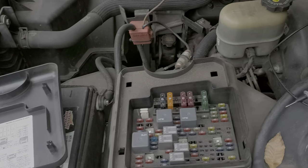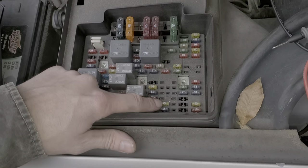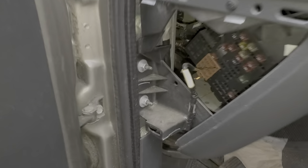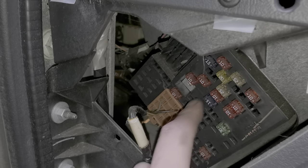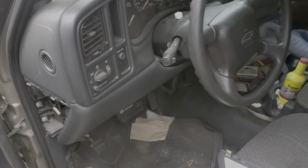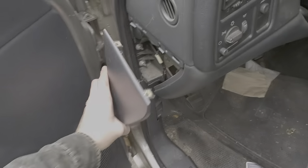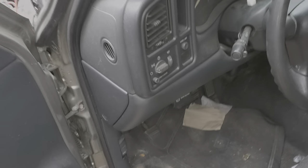So that's about it. You're going to want to check your 40 amp there, your 20 amp right there, you can tap on that relay or swap it, and you'll also want to check your crank fuse right there. You can try putting power on that fuse directly — that basically bypasses your ignition switch. I hope this was helpful; there are some spare fuses on the back there. Let me know if you guys have any questions, or more importantly, any advice about troubleshooting the starter on your Chevy Silverado.